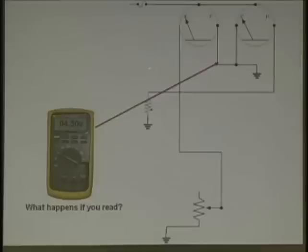Where's the what? Oh, we're coming to that. Don't worry about that. You got numbers there. You got 4, 5, 2, 3. They're different questions. Just pay attention to what's up here right now, and then you can write the note next to that number. So right now, the 4, 5, if you circled it, you would say there's high resistance here, and the fuel gauge would not work accurately. That's what we're looking for. All right. Okay, next one, Rich.